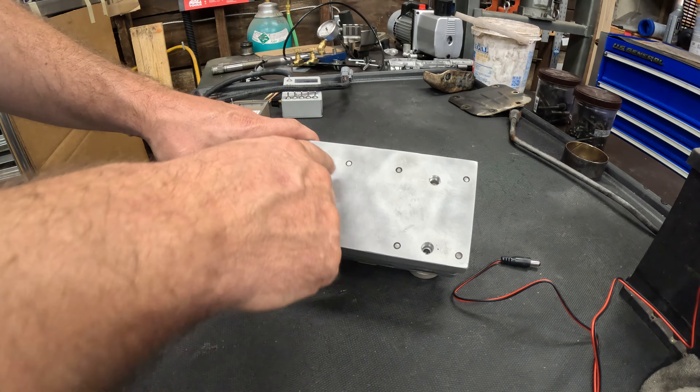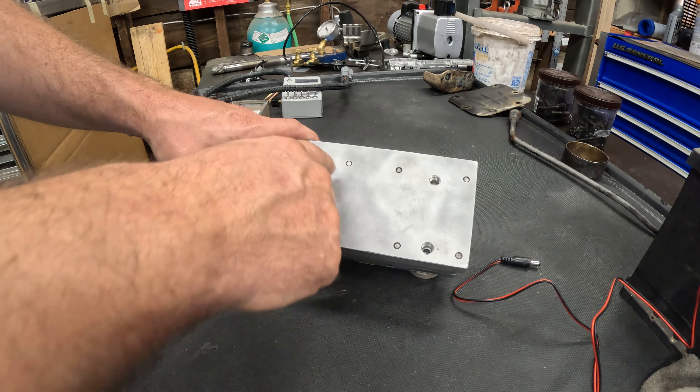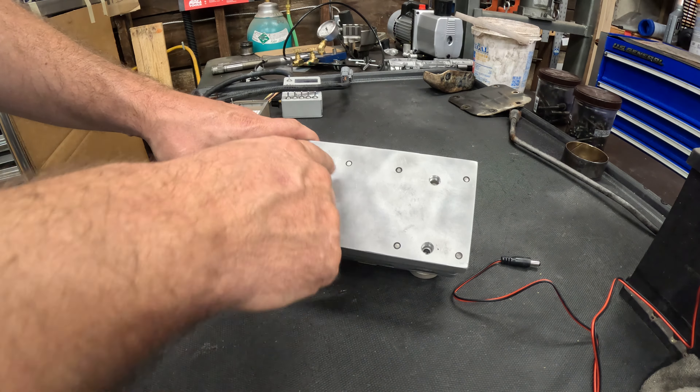If I want to pump fluid back and forth through them I can do that — I can put some fluid in there, blow it out, blow it the other direction. It usually doesn't get that deep; I've only had a couple I've done that way. Normally at that point they just go into the parts box and I build a good one out of a bunch of old ones and keep them going. That's the advanced way of checking solenoid packs — having a setup like this really helps me get through everything quickly and accurately before I send a new transmission out to a customer.